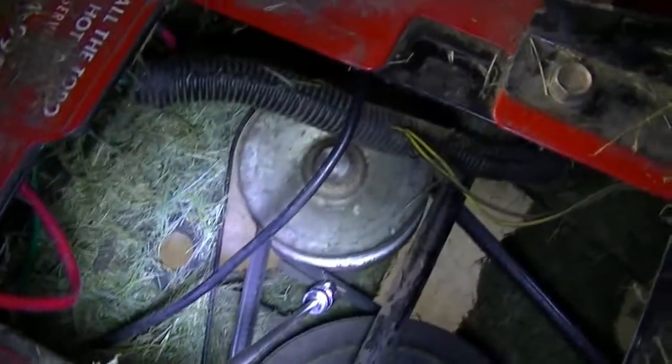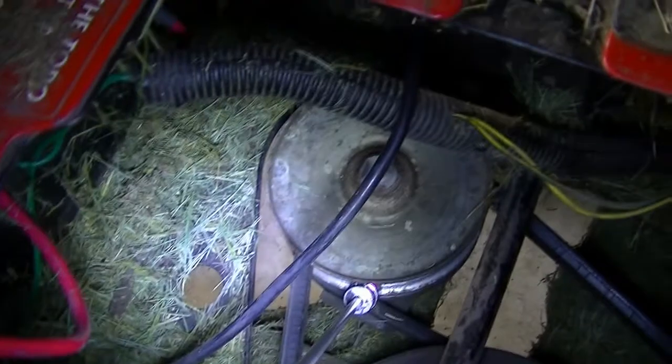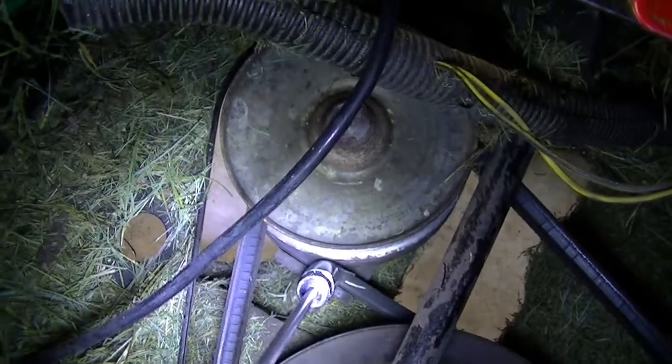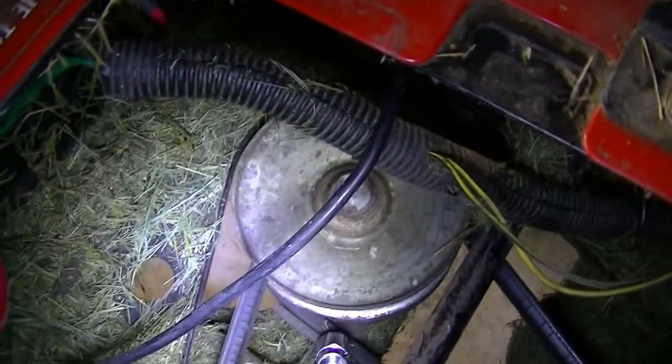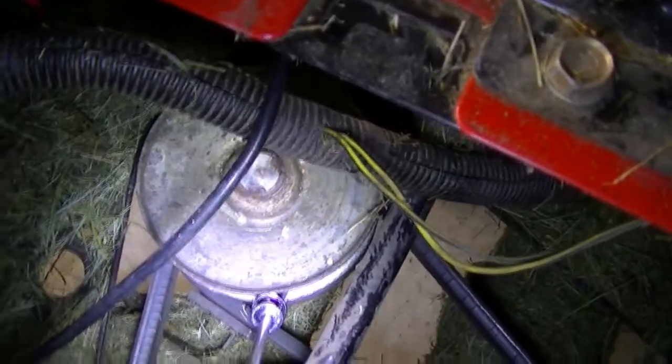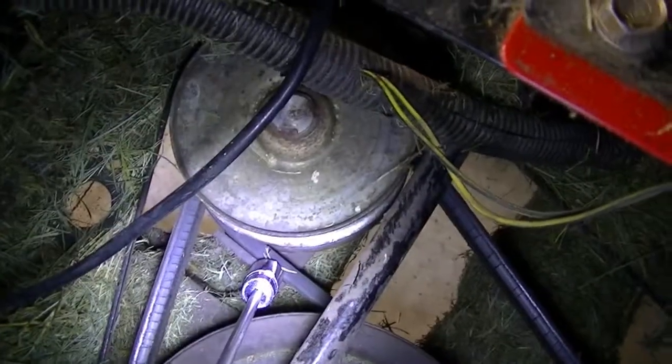So the middle part of it, probably it's not going to take that shot. So this second belt that is going below the pulley has a guide around it. This is the guide that is stopping this belt. But if I take out the upper belt and then move this middle pulley upwards, then I can pull this belt upwards out of this guide and take it out.